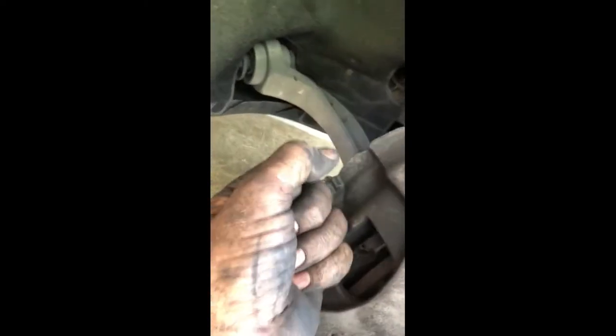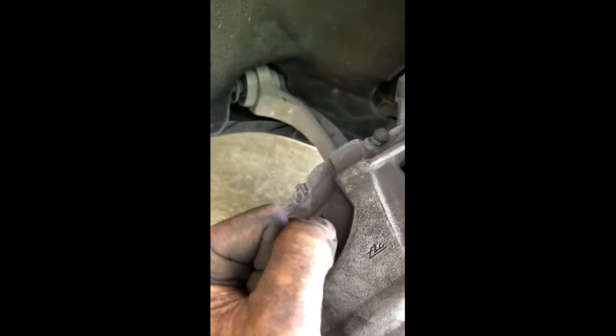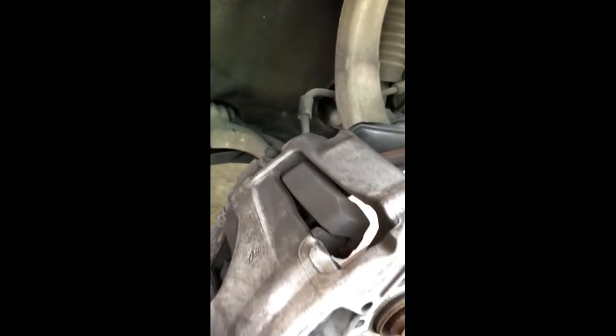I got two of them out of there, and they go out of these holes right here. There are little plastic clips, little plastic things that pop out of there. You just pop them both out, and then you can access that bolt. I'm going to go ahead and remove this brake sensor — you just pull it right out, not a real big deal. I want to show you how you pry the screwdriver back so you can push those pistons in, that way you don't have to mess with C-clamps or buy any C-clamps.